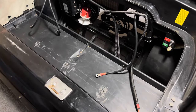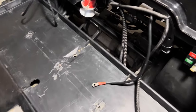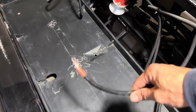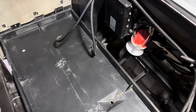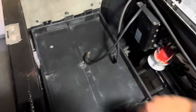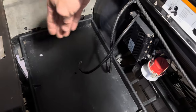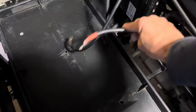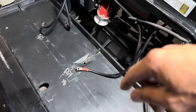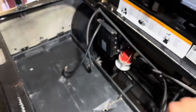Because the 160 amp hour battery is long, we are going to have to extend one of these main positive and negative cables. If we run the battery with the post on this side, we would have to extend the positive because it's not long enough to reach around. And if you want your terminals on the driver side, you would have to extend your negative cable.